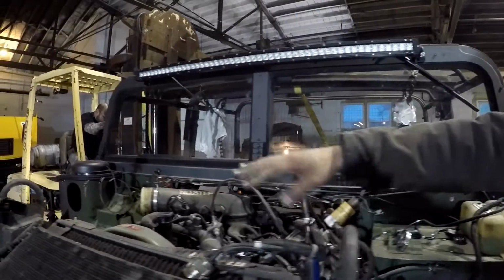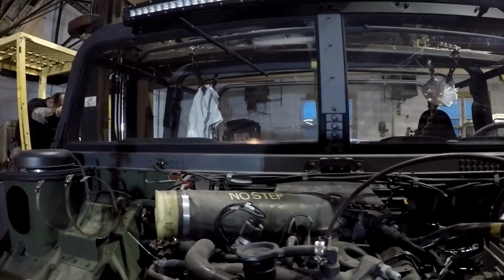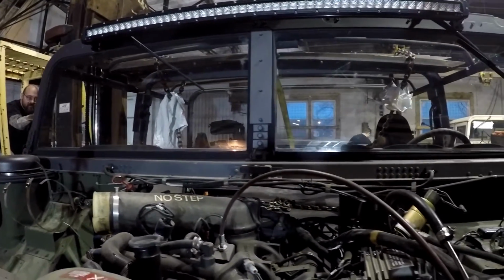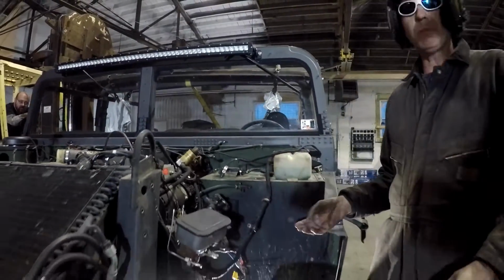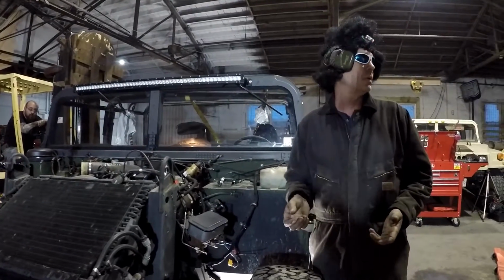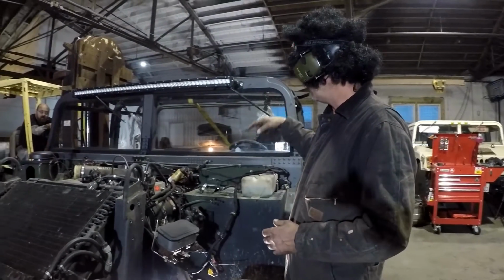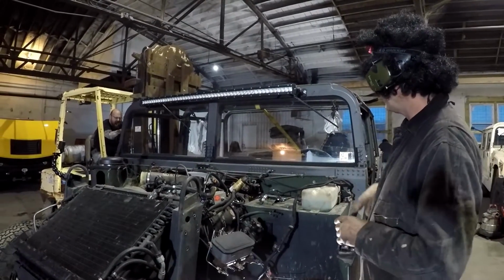Intake system, you see we pulled that off. Just pull the air box, everything's a couple of big hose clamps actually holding that on. Get that air box out of the way, get the cooling overflow or pressure tank out of the way, and then you can move into your body bolts. There's 6 body bolts on the Humvee. They're the big bolts. These bolts are 13 or 15/16ths, top and bottom. Knock those out, six total. Get those out of the way.